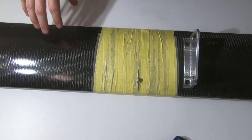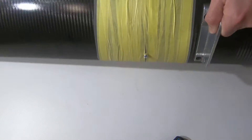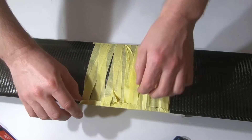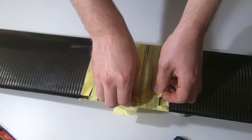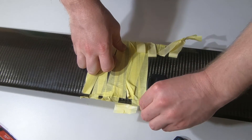This layup's now had plenty of time to cure. In truth it's been sitting here for about four weeks due to my work schedule and I've been putting off de-molding — unwrapping it — to get the camera out and show you guys what I'm doing. Just being careful to cut through the tape only, choosing the area where the tape had been bridged. I don't want to put a score mark on the very nice carbon fibre part, and this is all an out-of-mould surface by the manufacturer.